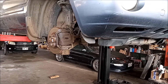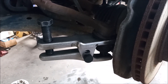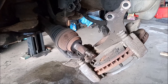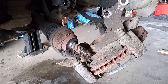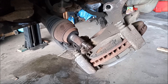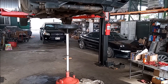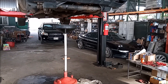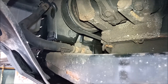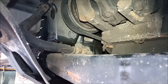The wheels are off — let's get the axles out. To remove the tie rods, I use a tie rod removal tool. The axles are out, both sides. Next, I'm going to remove the hubs. This is not really necessary but they're just in the way. I'm going to drain the engine oil and drain the transmission. Don't forget to disconnect this power steering cooler hose right here — it goes into a tube on the subframe.